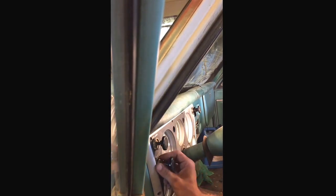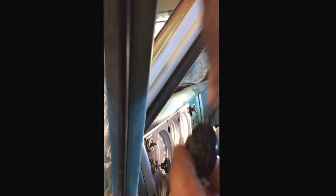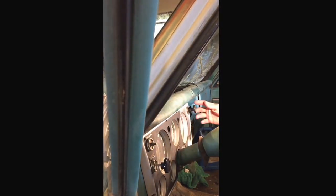This little bracket right here comes off beneath the steering column. Now for these knobs — this one I did take off earlier and it was really a pain, but there's a very very tiny screw in there which I needed this little screwdriver for. If you loosen it up it makes it come off easily, so loosen that little screw up and it'll slide right off. These other two on the '68 — I have a choke and I have my lights — they're a little bit different.